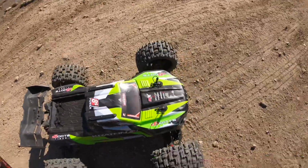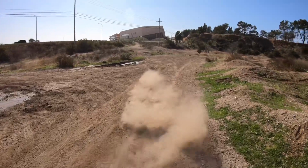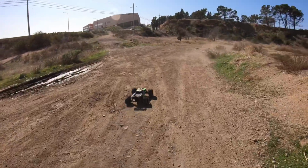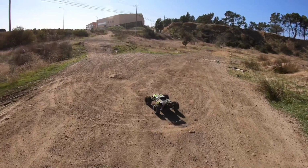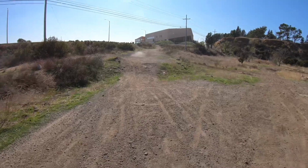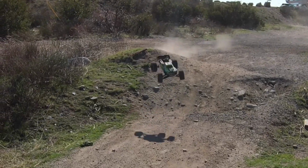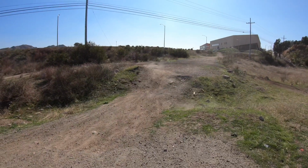That's disheartening. Whole reason to run this was it's a sensored system. But definitely a lot more power without that sensor wire hooked up. Now it's acting like it should. So it was never battery voltage. And it's funny because in the data, you can't tell if the sensor's getting signal or not. But that's exactly what it is. So I'm gonna have to turn off the sensor in this Coke can motor just like the other one. I had a feeling it was that sensor wire.